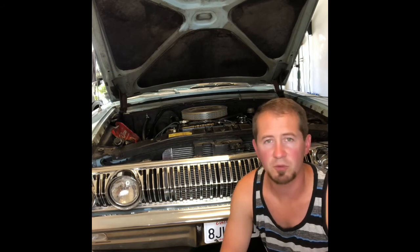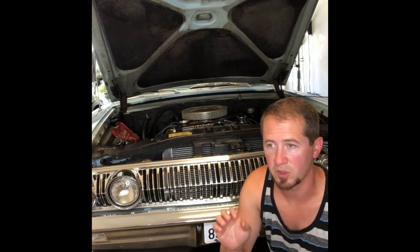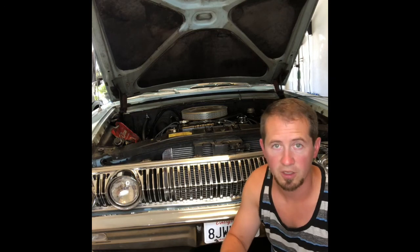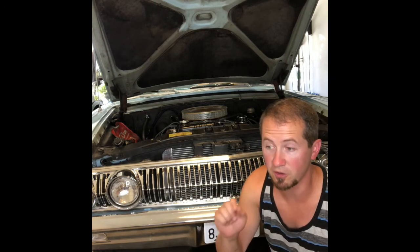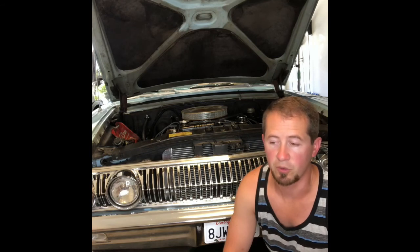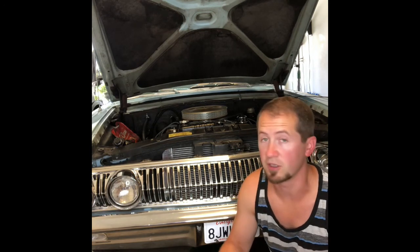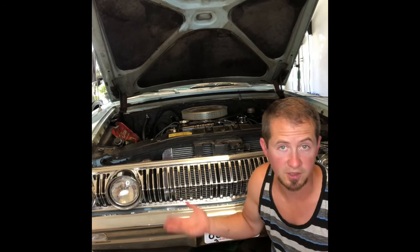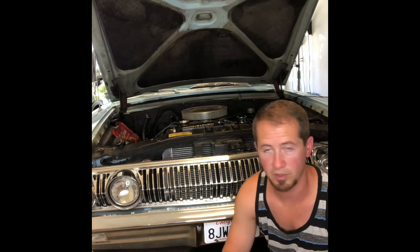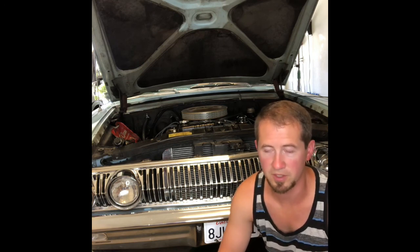One thing I don't see a whole lot mentioned is that on an automatic car like this, you want to make sure that's done in park. You're setting the IAC between 3 and 10 with the minimum amount of load on the engine. Like this one has an electric fan — electric fan off. Warmed up all the way to idle, make sure the target idle is somewhere near your idle set point. I'm at 640 for an idle set point with as little load as the engine is going to see. The IAC is going to come up when you put it in drive, come up a little bit with the fans on. If you have air conditioning, that's going to bump the IAC up as it brings up that idle. But really you're setting the throttle blades to the engine's minimum load, and that will get your IAC between 3 and 10 by setting those throttle blades.